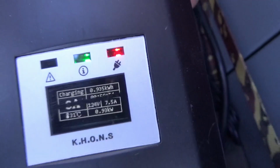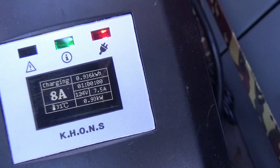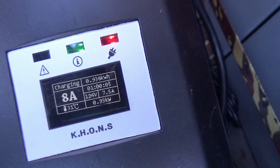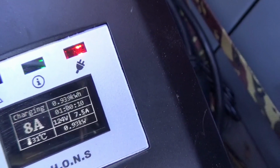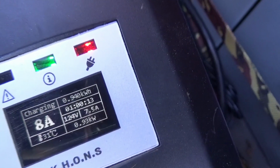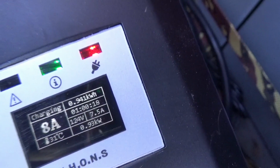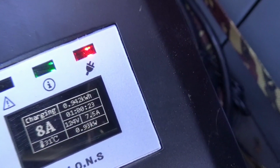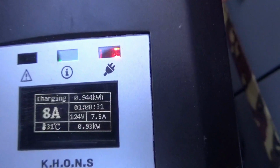I've heard of people where there's 2 people in the household, and they split the electric bill. They're like roommates, and whenever the power bill comes due, if one of them drives an EV and the other one doesn't, there's always a little bit of dispute over how much power was used. So this little clock up here will stop when you unplug the car, and this little EVSE will actually keep track, as long as you don't unplug it from the wall, of how many hours you charge and how many kilowatt hours were used. So that would be one way that you could settle any disputes about how much power your roommate was using to charge their electric vehicle.